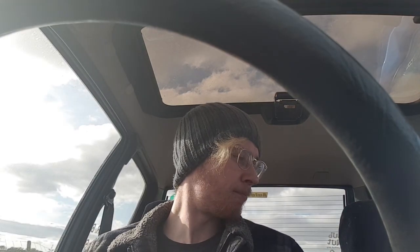I forgot to mention that actually it's running a BMW 320d inline fuel filter rather than the standard XUD one that sits on top of the engine, because the original one leaks, and similar to the HDI, they all leak. So obviously Peugeot didn't really learn anything from that. Other small plans. I don't want to talk too much about big plans right now. We'll get to that.